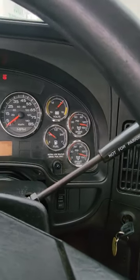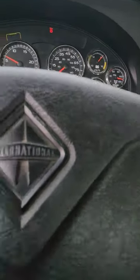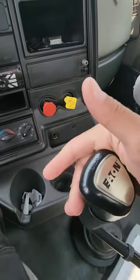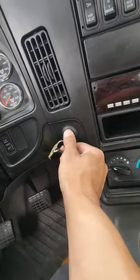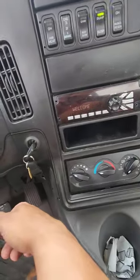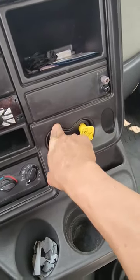Now, we are going to go into the air brake check, which is the applied brake test. So I'm going to go ahead and put the truck in first gear. Clutch down, first gear. Turn the truck off, keeping your foot on the clutch. Once the engine settles and it stops moving, slowly release your foot from the clutch. Give me electricity because I need electricity for the gauges and the lights. And last, I'm going to push my valves in.